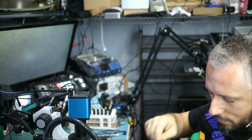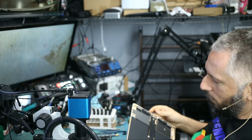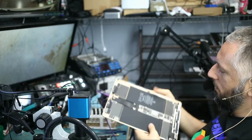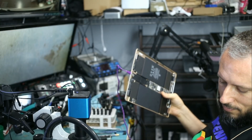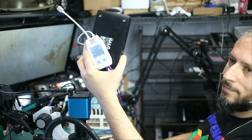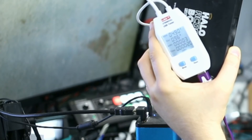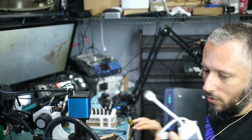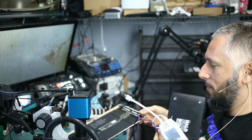The first thing I want to do is monitor the amperage being drawn by the tablet to see if we're still getting the same 0.45 to 0.48 amps. Let's plug the charging cable and look at that — 0.96 amps being drawn by the tablet, and that's normal. 0.96 is normal, so I'm almost positive the tablet is going to work.